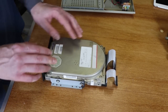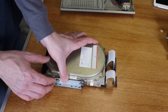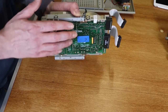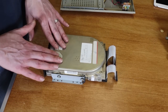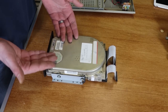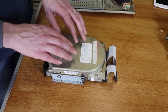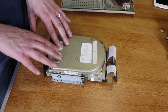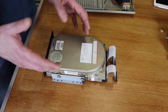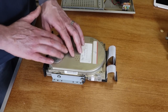The difference between MFM and RLL isn't actually that much. Physically, they're identical. The only difference really is the firmware that's loaded on the control board. The difference primarily between MFM and RLL is the encoding that is used to read and write data to the physical drive. MFM on this physical drive would only format to 20MB. The short version is MFM is only limited to 17 sectors, while RLL can do 26 or more sectors on the hard drive.